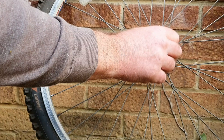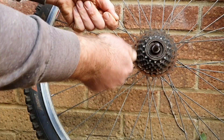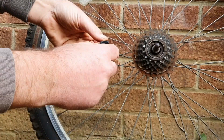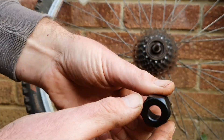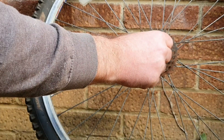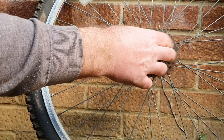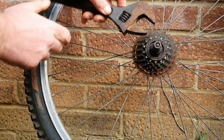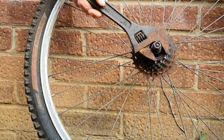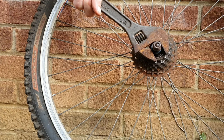To get the freewheel off on a cheap mountain bike there are other ways using a chain whip and another tool. With this one it's all complete and you get a special tool like this with little splines on it - a little nut thing. You put it on there, put on the rear wheel to stop it coming off, then get a really big spanner and you have to use serious muscle because this thing is done up real tight.